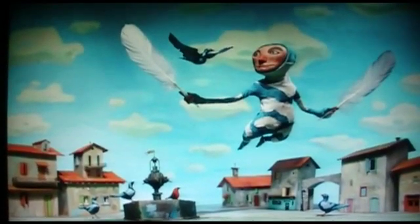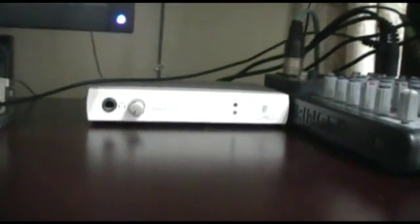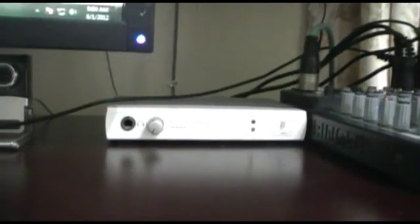Now what we are going to do is install the audio interface driver — the firewire interface driver — on my computer. Behringer has not come up with a Windows 7 driver for this interface, which is disappointing, but a third-party company has made an audio driver for this interface. What you have to do first is unplug and disconnect your firewire from your audio card end. So as you can see, I have not connected my firewire interface yet. Remove the cable from the device side — not from the computer side — and then start the setup.